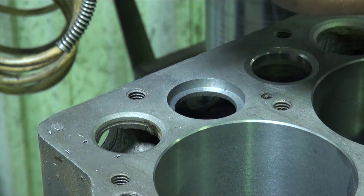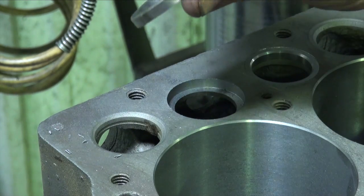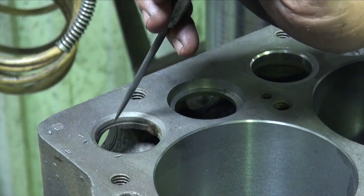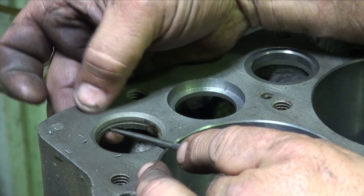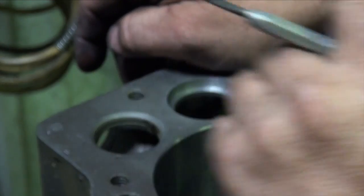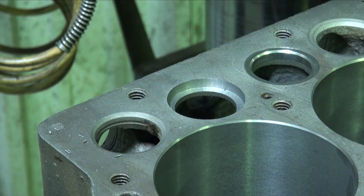Just because the seat's this dimension doesn't mean that we have to use it all. If a guy was to just say, hey, we're going to put this seat in, it's got to go in regardless, he's probably going to ruin the block. What's going to happen is whenever it falls through the floor, as thin as this port is, eventually the block will crack across right there. Right, yeah. And by cracking across there, it's catastrophic. It's done. Right. Yeah. So just a few tips and pointers.